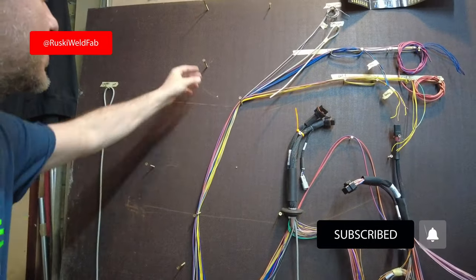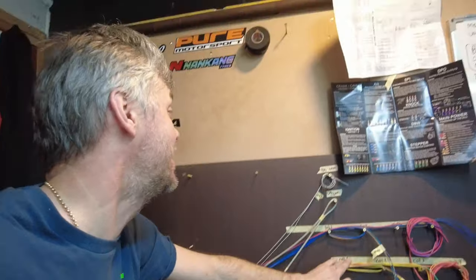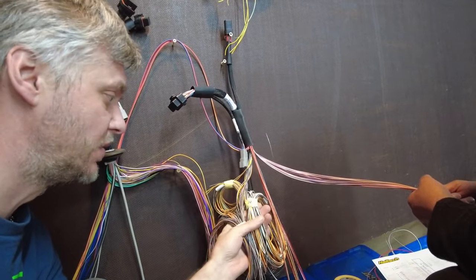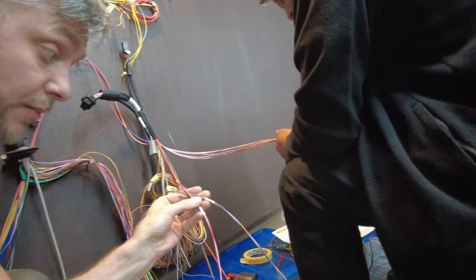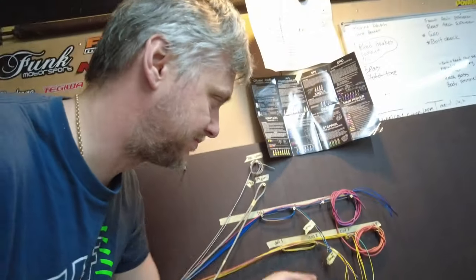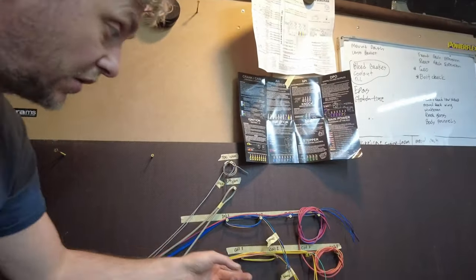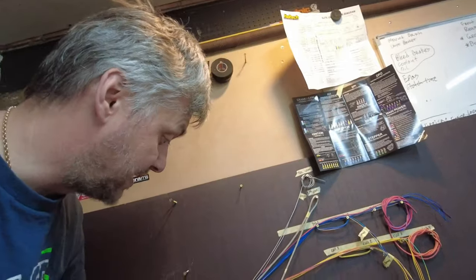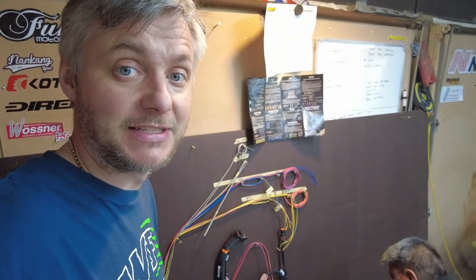You just need some 80mm or 100mm screws into the wall and then label everything — masking tape and a marker is your best friend. With this spaghetti, even those wires we've just categorized — SPIs, AVIs, all the inputs — it looks really messy right now, but you still label them. Haltech does label it for you on their loom, but if you're making your own loom, you'll forget where each wire goes. You'll also notice spares — that's what I was saying about running extra spare wires. I don't need eight coil outputs, I'm only running four coils, but I won't cut those out because they're already pre-terminated.